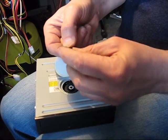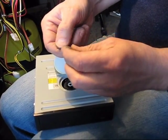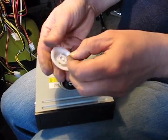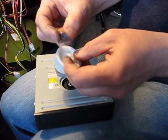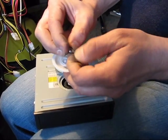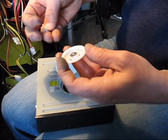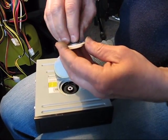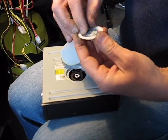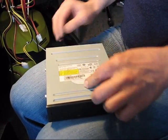So that's our magnet after grinding. We'll try to put it back. The side that was ground goes upwards so that the other side, which is flat, goes down to clamp with the CD spindle. We'll place back our magnet here and close this.